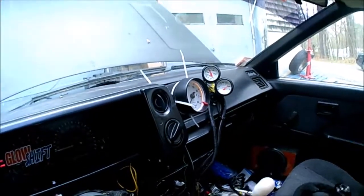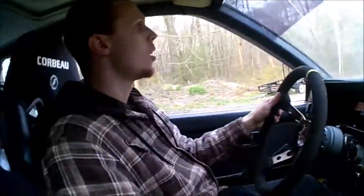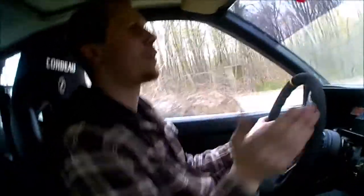Under regular load, it just starts breaking up and it doesn't want to move at all. Also, because of my radiator issue, I'm running really hot with my dinky fan. I sprayed some water on the radiator and let the fan run to cool down. We only got to 180, but it would just keep climbing, so I can only do this for short trips. But it moved - we drove it a little bit. Just little bits of timing adjustment. We were trying to put the timing as far before TDC as we could, and now we're going after 10 degrees.